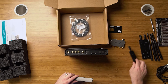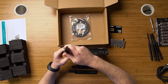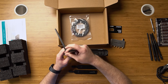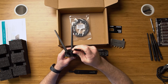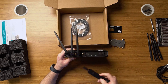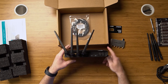Now let's move on to the cellular antennas. Typically this device is going to be paired to an external antenna with multiple leads coming inside the vehicle. Today I'm going to show you with standard cellular paddle antennas so you can get an idea of how these are set up. You can run these off of cellular paddle antennas, but for superior performance you definitely want to put an external antenna on your vehicle. Now you might be wondering why there are four LTE connections — this is for enhanced carrier aggregation capabilities. Typically the older models had two LTE leads, and these will actually do 1.2 gigabits per second over the air.